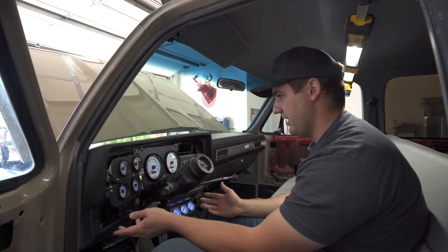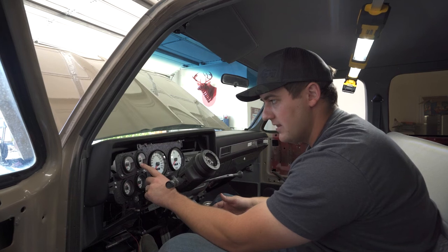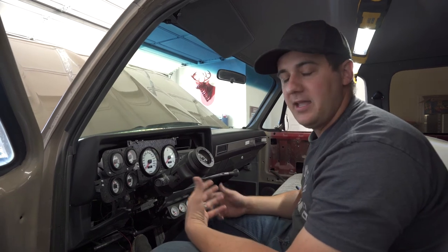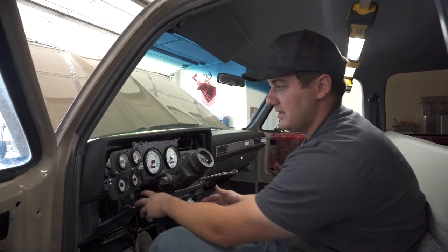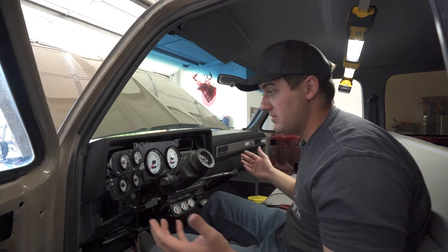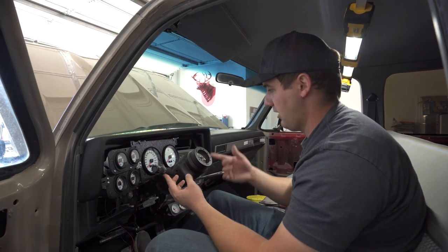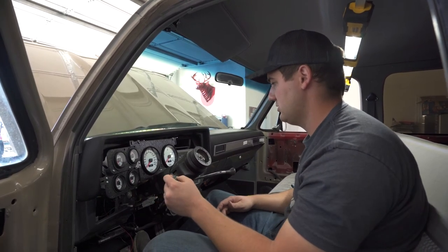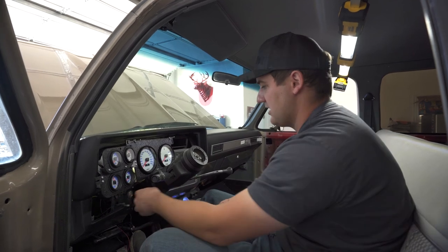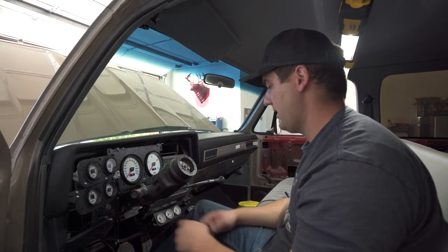Let's make sure our lights work. We turn them on — we've got illumination on all of them except for one. One of these is not illuminating. See, that's why we check. I can go in there now and I know that one has maybe just come disconnected from the main gauge or something. If for any reason you have an issue, make sure you write new vintage and let them know — they'll always replace anything that you need. Our right blinker works. Looks like our turn signal switch might be bad though because I'm not getting a left turn signal and I'm not even hearing my relay kick on. But still, signal right works. When our headlights come on those come on, when our brights come on I get my little bright indicator. It's looking great — I'm pumped.